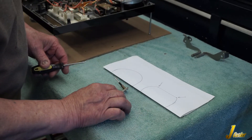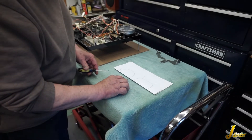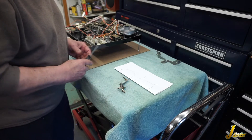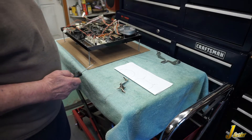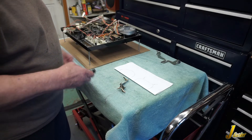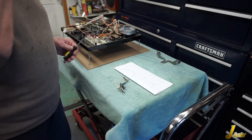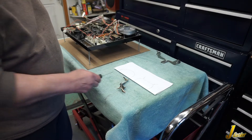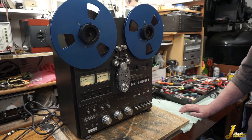When that tape is running like that, you're hurting the surface of the tape, even though some people may think you're not. That becomes very evident when you see how badly that tape lifter gets worn. We'll show you a little later on how normal tape lifters operate, and you'll be able to see the buildup that gets onto these lifters. We're going to take this head assembly off so you can see how these bearings affect the movement of the tape.